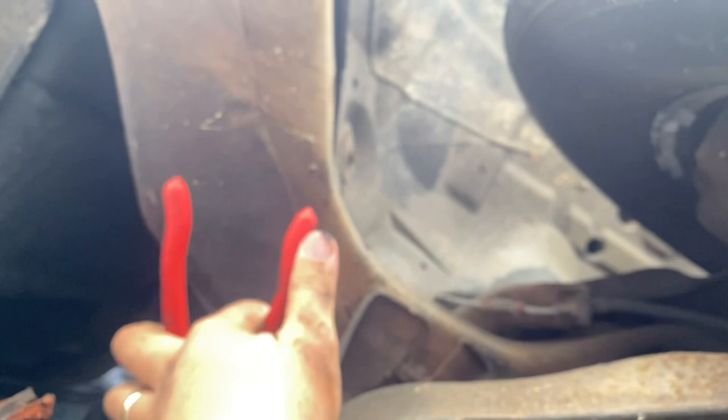Let's find our oil filter. It is over here on the passenger side, just right above the exhaust manifold — this header. I'm going to see if I can reach in there and turn it by hand, and if not I've got a set of oil filter pliers. Looks like we're going to have to use those. Get our pliers on here, give it a turn — just a couple times to get it broke loose. Should be loose enough that I can reach up in there and get the rest of it by hand.